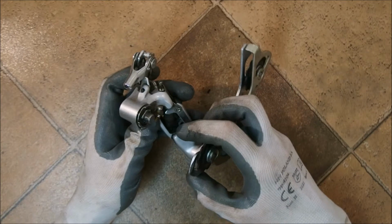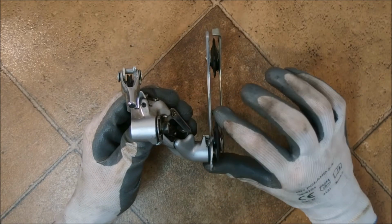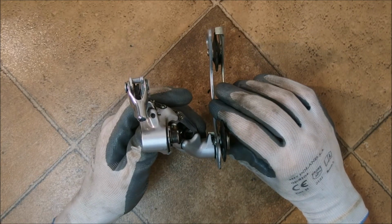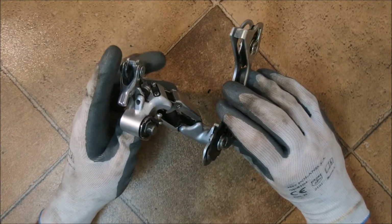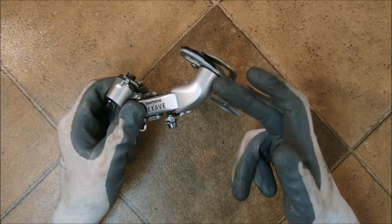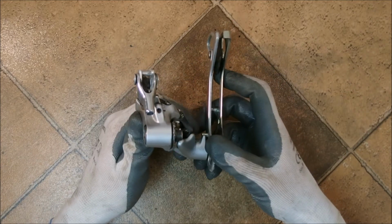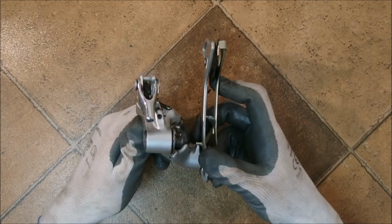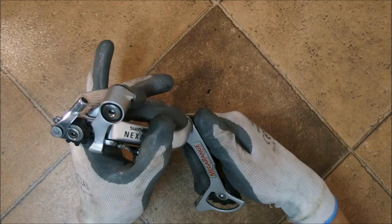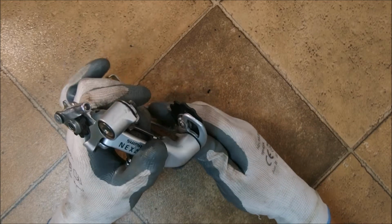In such a derailleur, the return spring positions the derailleur in the neutral position on the lowest gear of the cassette. This has two distinct advantages. One, it automatically puts the return spring and the spring of the cage in opposite directions. So if you are tensioning the one because you are shifting to top gears, you are actually releasing the spring of the cage. This provides for a very uniform and very light action of the lever.